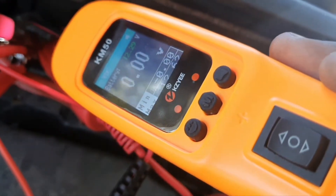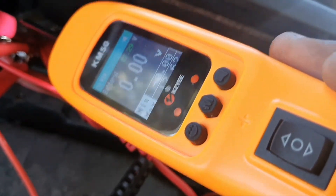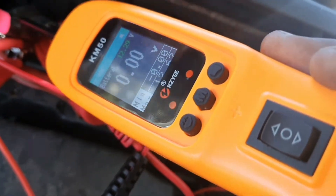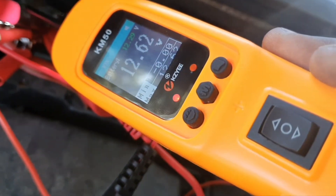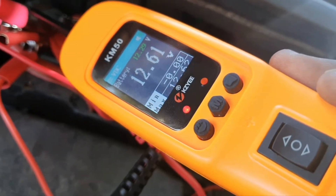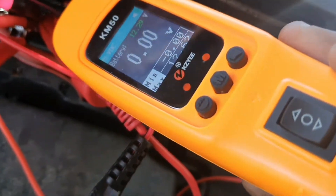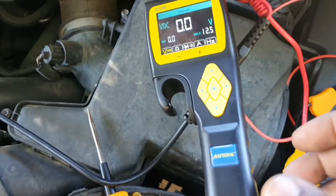It also seems like it's almost on a timer when it actually checks the circuit. I went off pace and it wasn't detecting — that can throw you off when checking fuses. So that's one issue with these digital probes. Of course, if you just hold it down for more than a second you'd get the reading, but if it's anything quick or intermittent you might miss it.